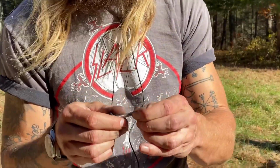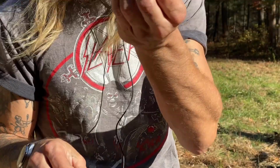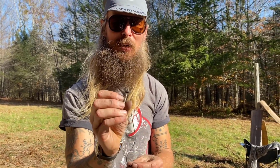You just want to make sure before you do the cutting that the valve core is removable. That's a valve core. Tubes, huh? Wow. Oh, wow. Assess, put back in. Make sure you cut tight around the edges. Of course, they don't have to be very smooth. And make sure you hold on to that little grommet. That's going to affix it and hold it tight to the rim.